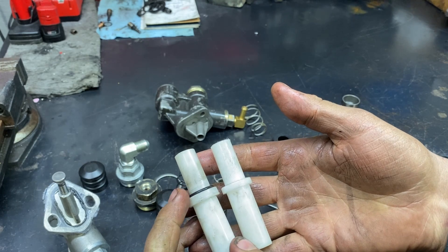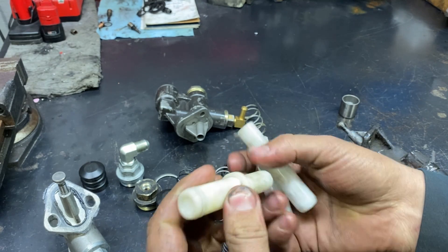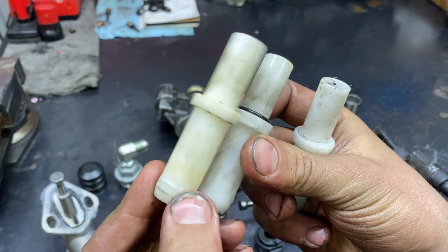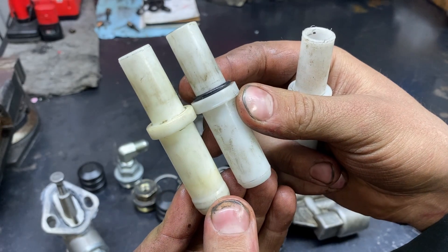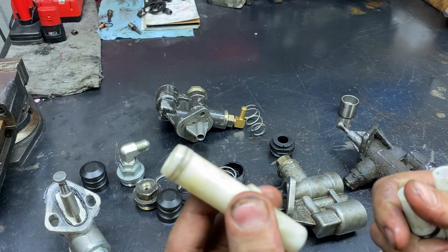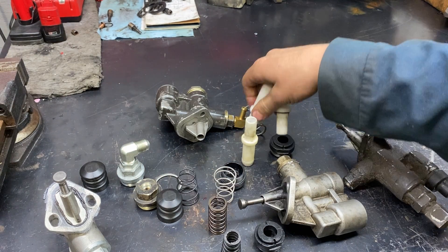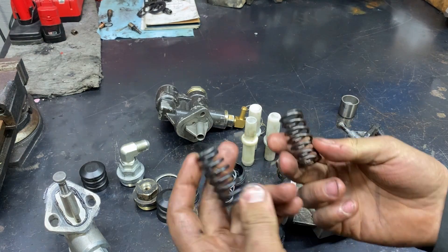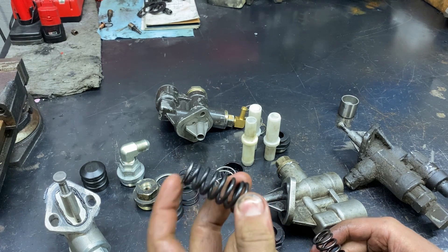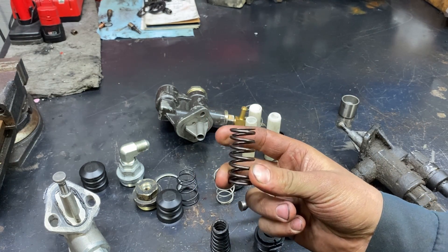All three pumps are different because they're from three different manufacturers. This one looks to have a reinforced seating area. This one is pretty straight and simple. This one came with an O-ring — the others don't have O-rings, so it's just an extra seal. The Carter original one has a reduced diameter with a raised area that grabs the lip seal really well — that's a better quality part compared to the others. The last failure mode: I've had a spring break inside them. It ran, but barely — low pressure, barely got home. These springs can break, and this spring right here is actually the hot rod part we'll talk about later.